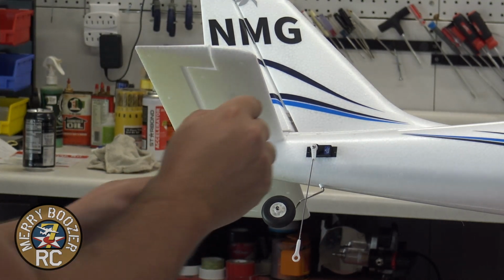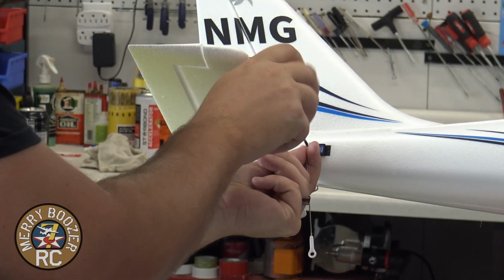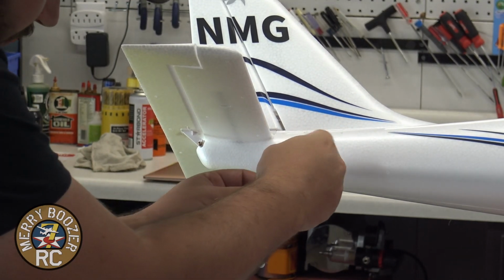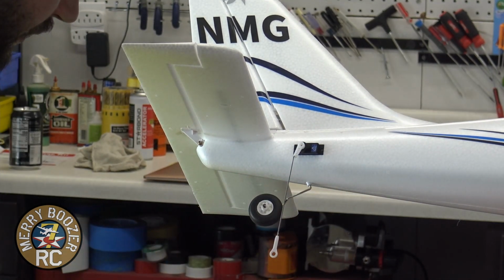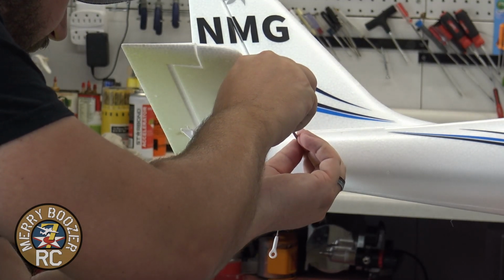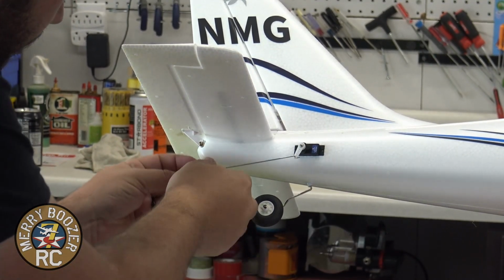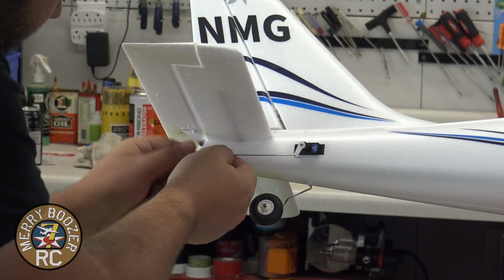So what I'm gonna do this time, I'm gonna actually take this off. I was getting to the end of my adjustment. So what I'm gonna do is unscrew that, pull it off. I'm gonna move one spline over on the teeth because I was running out of control rod. I don't know why it's doing that. Oh yeah, now it's a lot closer.